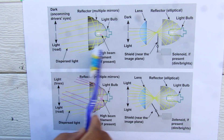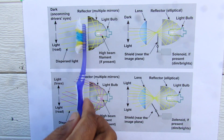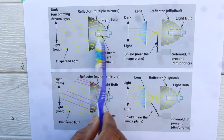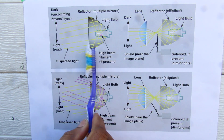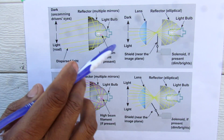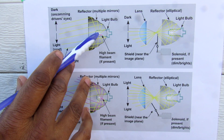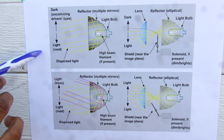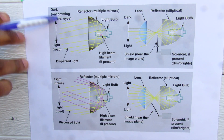Here we have a diagram of how the inside of the headlight works. Over here I've got the reflector in a low beam situation, and you can see we have these individual slats inside of here which comprise different angles for which the light can bounce off and form the beam pattern. In a low beam situation we have the point source coming in, and everything is going to point downward towards the road and out of any oncoming driver's eye.